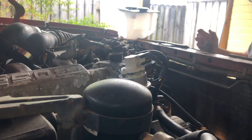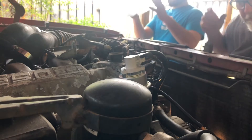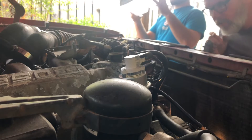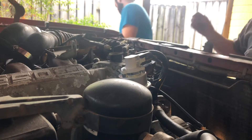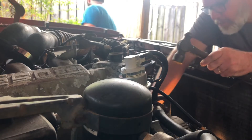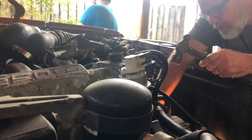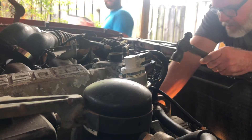My son is working on his '70-whatever, a '91 to '95 Ford truck, and we were putting a water pump on it yesterday and he snapped that bolt off. These bolts have never been out of this thing and it's very tight. So the first thing you need to do is take your starter punch and find the center of the broken bolt.